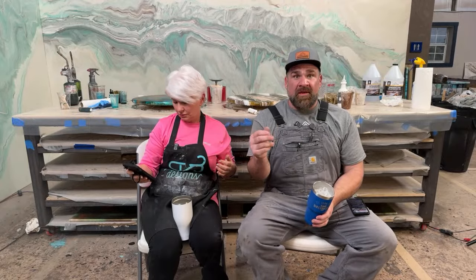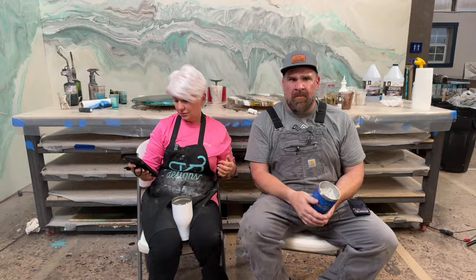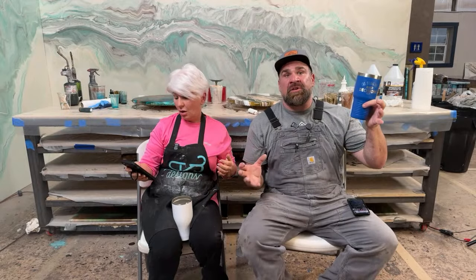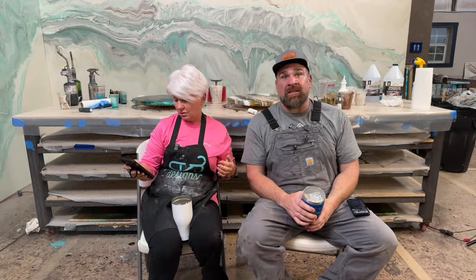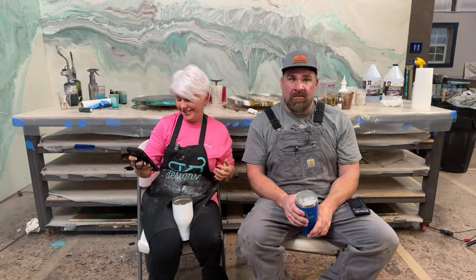Kenny grabbed some automotive Bondo. It's extra creamy. It's by 3M. 3M creates it. A lot of Bondo is the same formula. What's different about it? You have your all-purpose Bondo or your fillers. It's how creamy and how smooth it is. They're changing that consistency. So Kenny's is money. I love that new Bondo. You could get it in big gallon jugs. If you go to an automotive paint supplier or an auto body shop, they have great Bondos there, better than you can get at Home Depot.